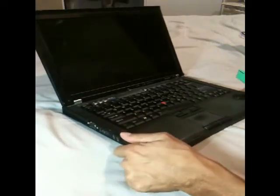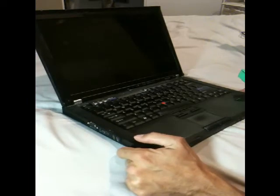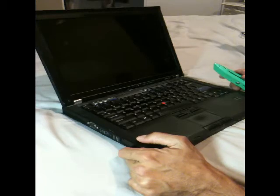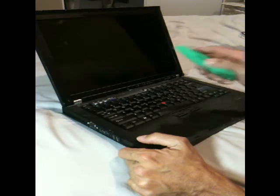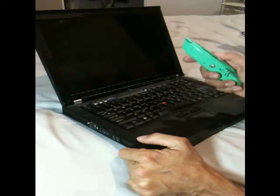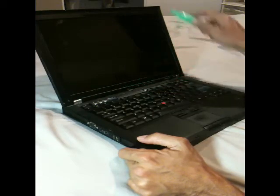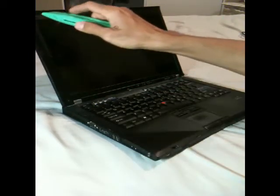The only challenging part when replacing the LCD screen is removing the frame liner. So it's the only thing I'm gonna show here. Actually, when replacing only the inverter, you just need to remove the frame liner. First, use a box cutter to pry out the cosmetic cover of the 5 screws and remove the 5 screws located here, here, here, here, and here.